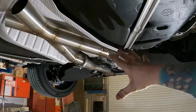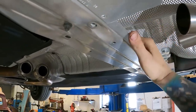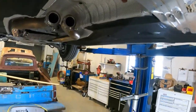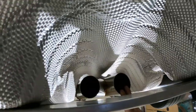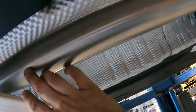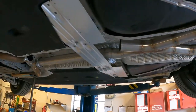Keel did a fantastic job welding this all up and it stayed pretty tight. We put it right back in the same spot. The original exhaust was designed to kick up and over this brace, so we're going to mimic that — taking some 45s, maybe cutting one in half, and rotating it to match. We measured center to center and matched the kick-up. We got one side tacked up with plenty of clearance, and we'll finish fitting and tacking the other side before a final test fit and weld-up.